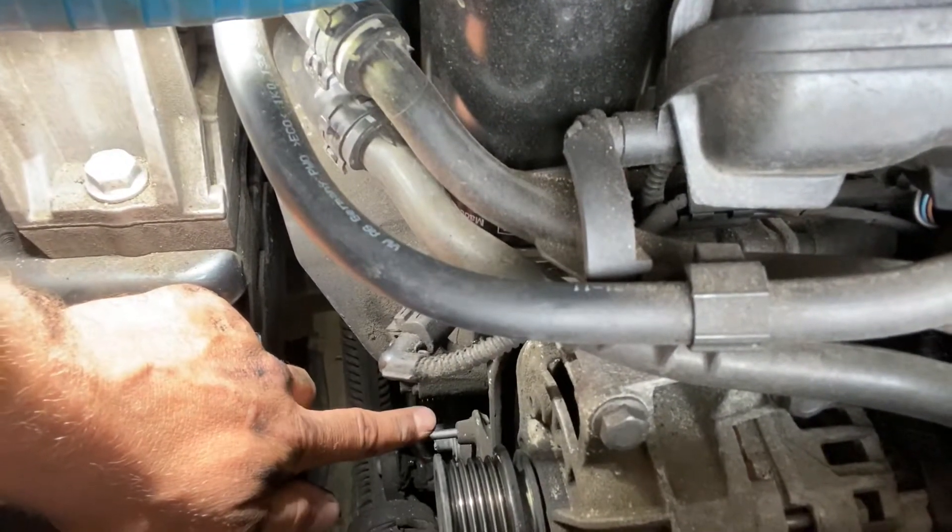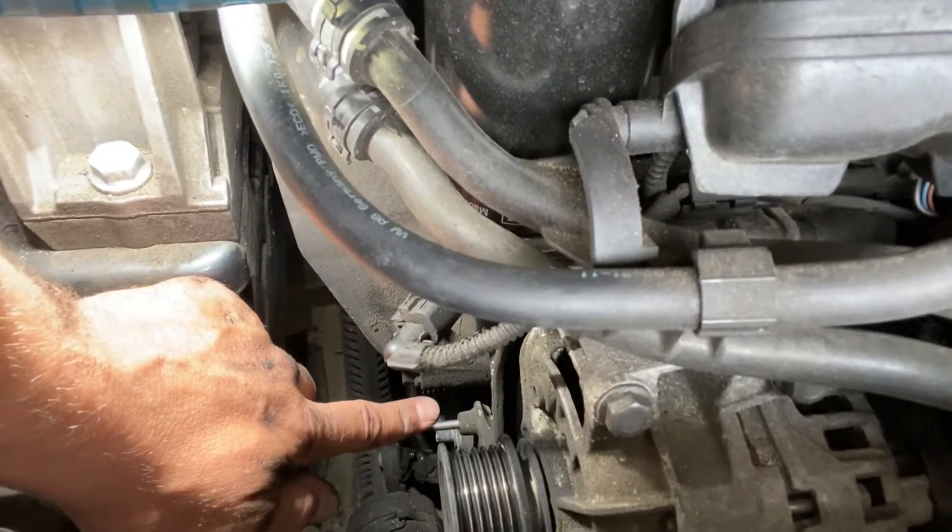The way they designed this car — it's a Volkswagen, my own fault — the actual tensioner pulley is automated on its end for adjusting. On most cars you can just pull the whole unit out, pulley and all, and slide a new one in and bolt it up. But Volkswagen decided to be geniuses and mounted the pulley so that if you want to pull it out, it hits the frame. To actually change the full pulley assembly, you have to drop the engine.